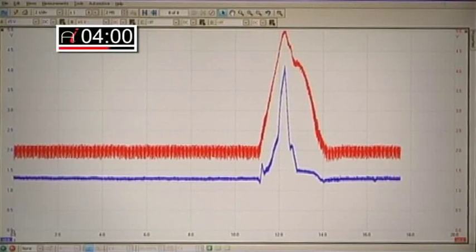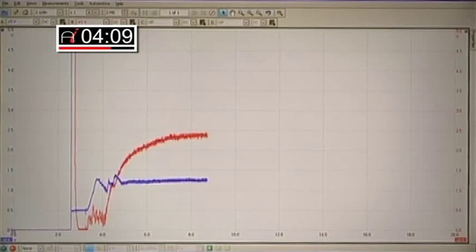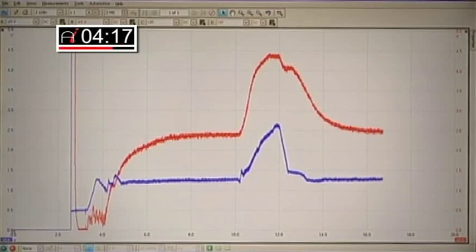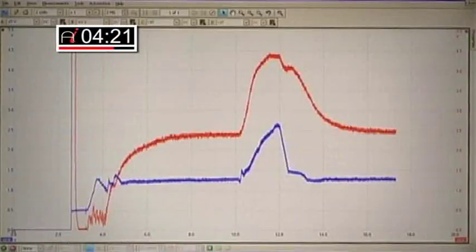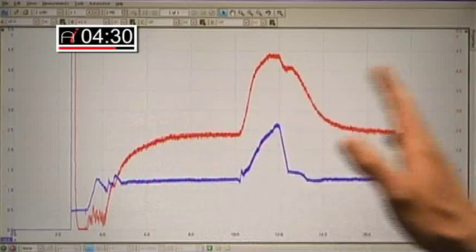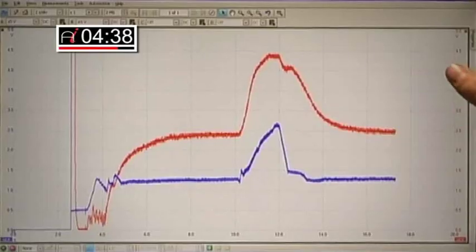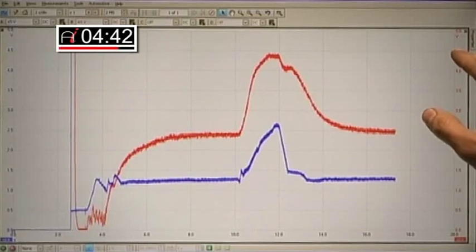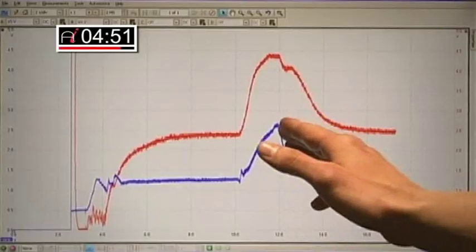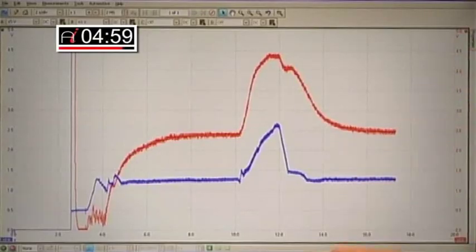As you can see from the results, we've got a much more sluggish performance. The actual waveforms are not mirrored anymore — they're very spread out, which shows how unresponsive the engine has become. My air flow meter voltage has dropped to just under 4.5 volts — only 0.6 of a volt drop — but it shows how much influence it has on the fueling. I've got much less pressure in the fuel rail: only 2.5 volts, down from 4 volts, just because of that 0.6 volt drop on the air flow meter.